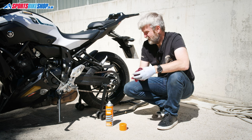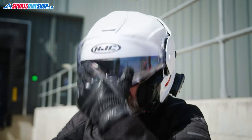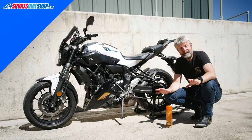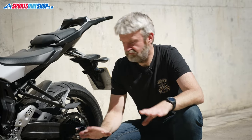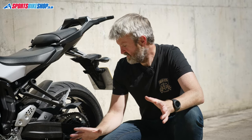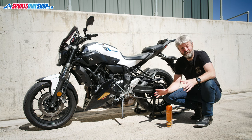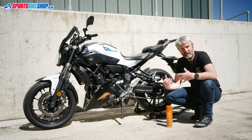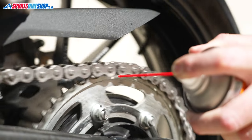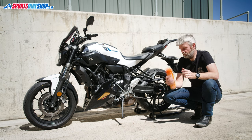The next step in my process is to take the bike for a really short ride to make sure there's absolutely no water left in the chain and to get it warmed up. That's more of an ideal-world step — if you get the opportunity, brilliant; if not, just make sure it's completely dry before moving on to lubrication. With a modern sealed chain like this one, the lube is really just there to avoid corrosion and protect from rust. We don't need it to soak inside; we just need a coating on the outer plates, the rollers, and between the chain and sprockets.